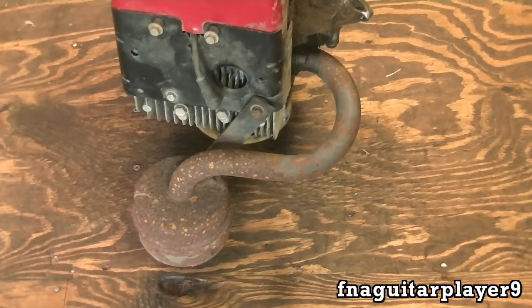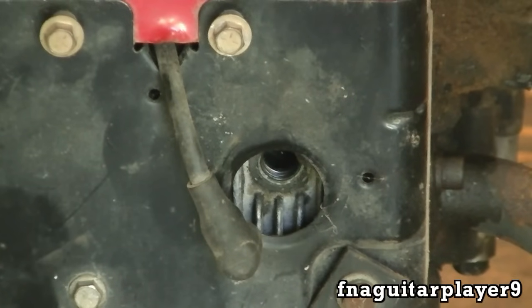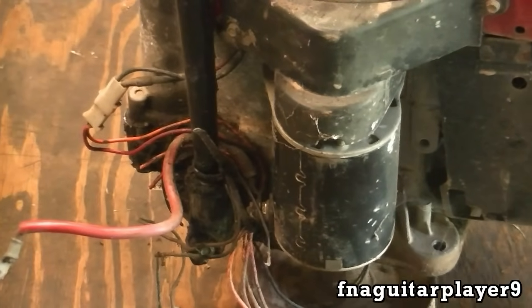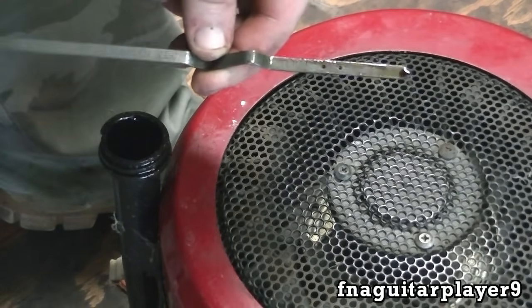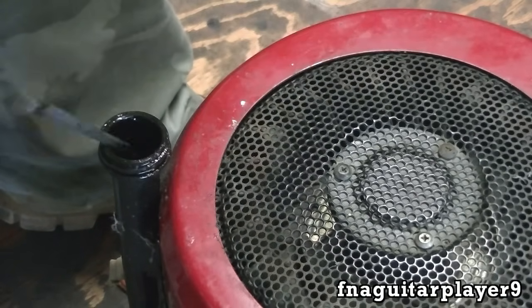It says quiet package installed — we'll see how quiet it is. It's missing the spark plug, which is no big deal, we've got some. It has a starter; don't know if it's good or not, probably is — most of the time they are. You can see the wires coming out for the recharge system. Checked the oil — it's low and pretty dark, so I'll put some fresh oil in it.